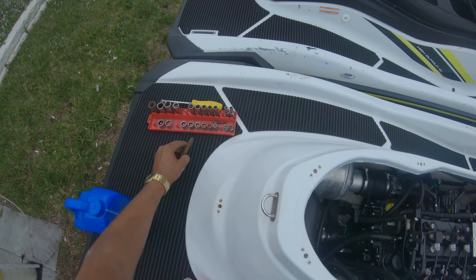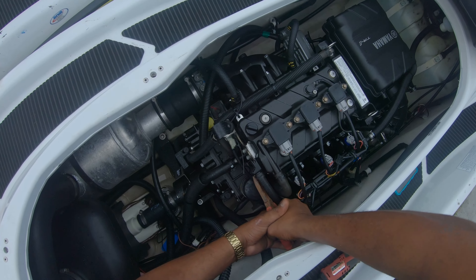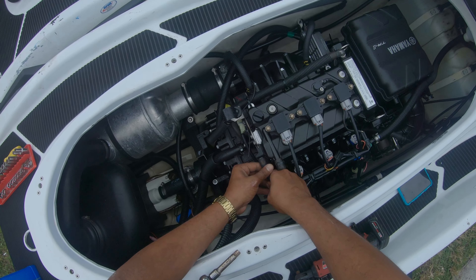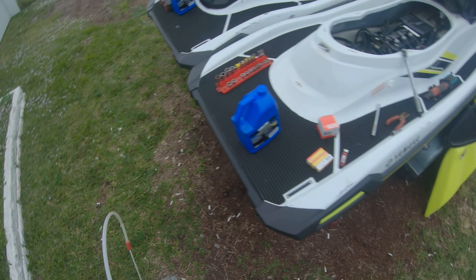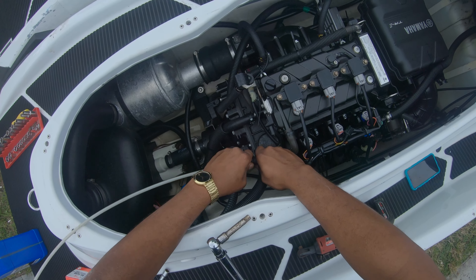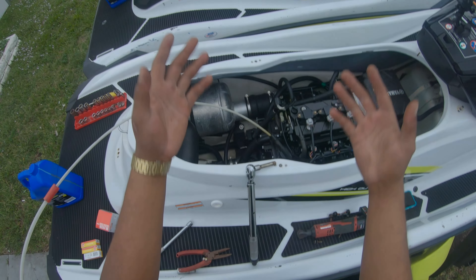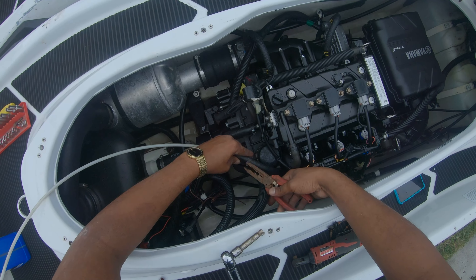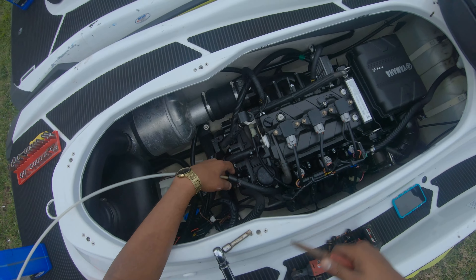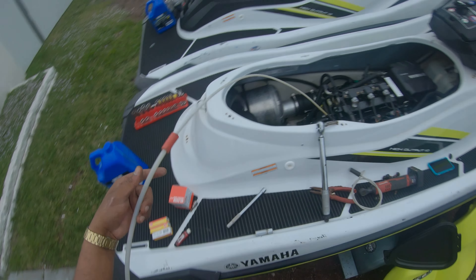So we're done with the spark plugs and now it's time for the oil change. We're gonna use these pliers — you can see this clamp right here, we're gonna just squeeze it right out. Perfect, just broke it loose. You can have any type of extractor. We have this one we bought at North Miami Motorsports — you can find it online too, it's not that expensive, like 120 dollars, holds up to about 30 changes, which is perfect because we're doing two today. Now let's move this clamp to hold our extractor. We should pump and we should see the oil start coming out automatically.